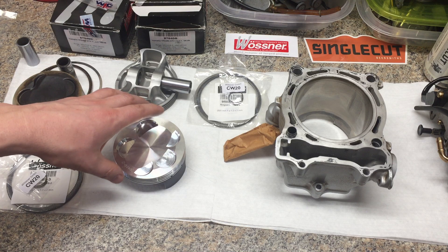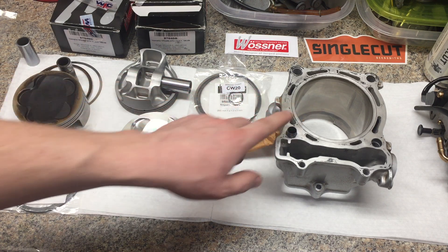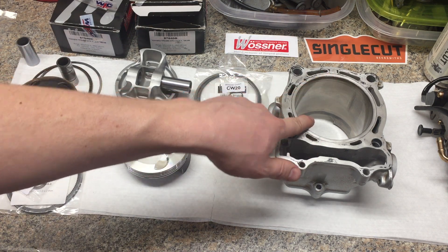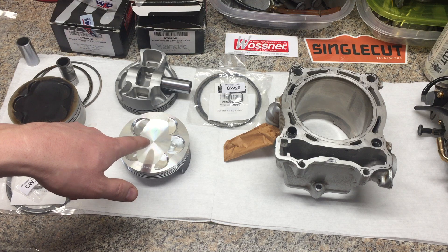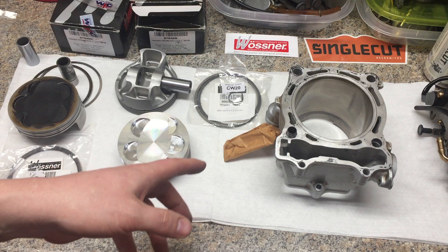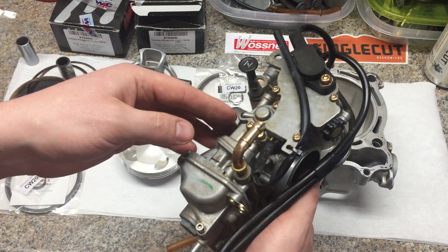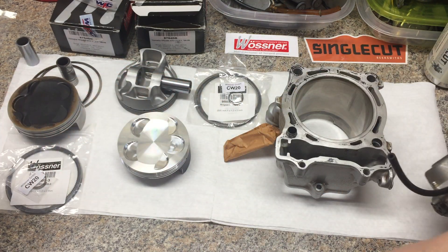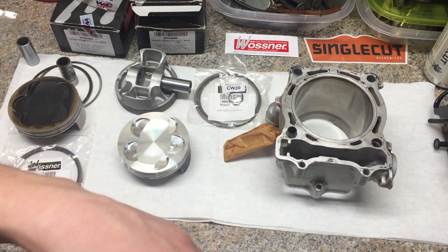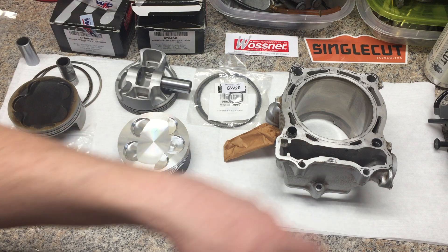I do want to get a little bit more in depth with measuring the piston and the cylinder and finding out where we're at with everything. So when this comes back from Power Seal, I will be validating the piston wall clearance and I have some Mitutoyo digital mics. The next video will feature going through this carb. Of all the videos I have right now about Project YFZ, the carb is the most popular — a lot of people have some issues with them, they sit around for a while, or they're having trouble jetting them.